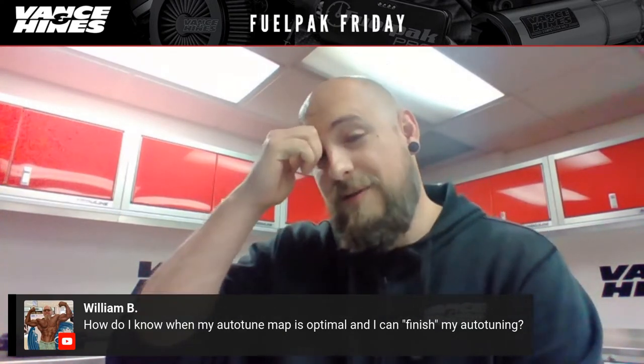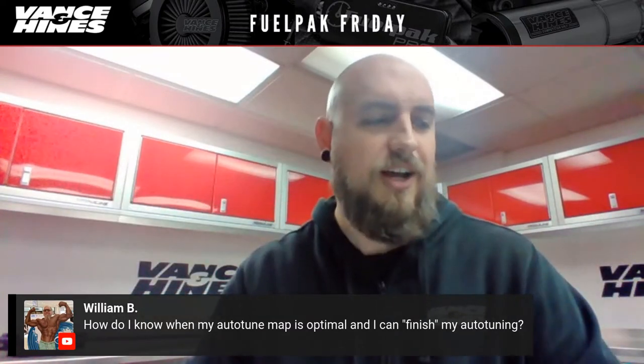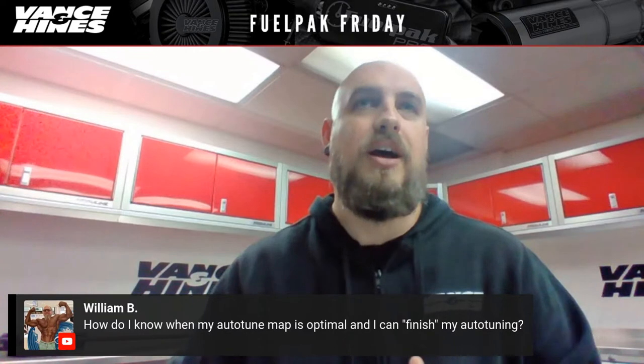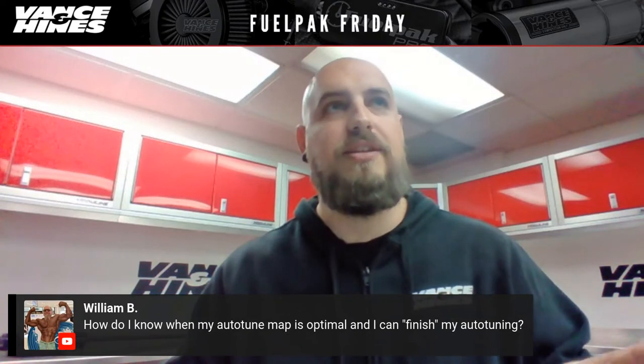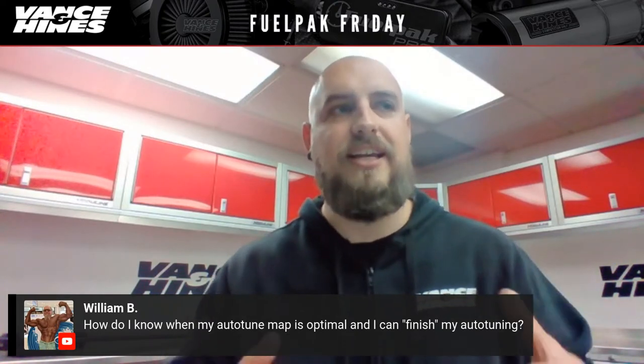How do I know when my autotune map is optimal and can I finish my autotuning? Asks William B. So a couple things. One, we added a preview tool into the FuelPak FP3, designed specifically, originally, for the FuelPak Pro. The idea being that if you look at your volumetric efficiency delta tables, you can see the gradations and the degrees of change that are happening run to run. And once you get to a point where it's not making any more changes, once it's polished and the whole map is green within those VE delta tables, you don't have to do any more autotune sessions.